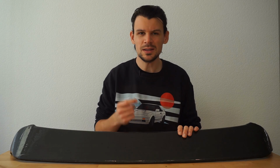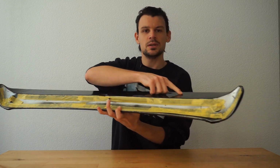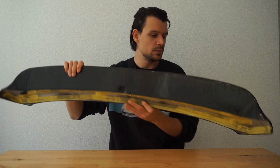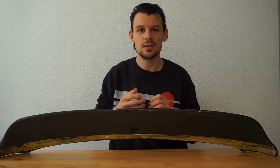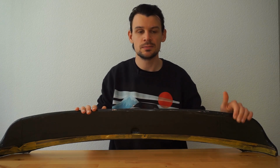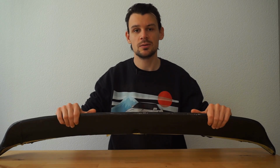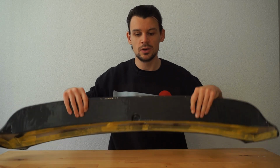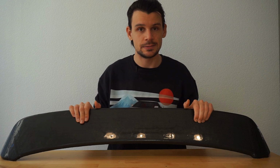But when you just have very small amounts of it, then it leads to a wrong mixture or a wrong ratio, and this leads to some sticky resin. And you can see that because after all of it, it makes some dark spots because it is sticky. You cannot sand it really good, and everything like dirt or dust stays on the spots. So this was a mistake you really can avoid by using the volume which you can handle. Mixing a little bit too much is better than too little.